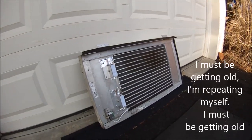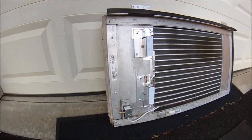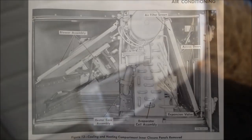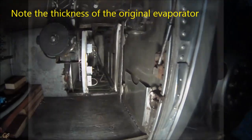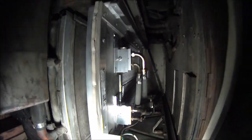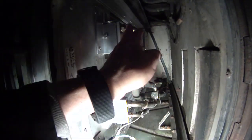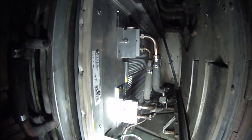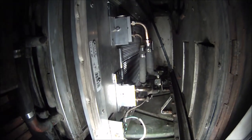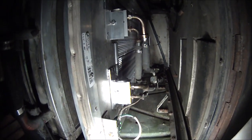This time the coils are the same size — the last time one was a little longer than the other. These are the expansion valves right here, and that is the freeze shutoff: the coils freeze and it senses that and shuts it off. So that's what we're going to slide into our HVAC compartment. Now I have the evaporators hooked up to the lines and expansion valves. You have your high pressure lines on the bottom of the expansion valves, and your suction return lines to the compressor on the top. There are two evaporators here, which is why you see two expansion valves and two sets of lines — they tee off right before they get to the evaporators.